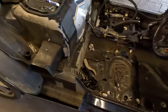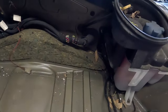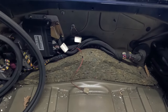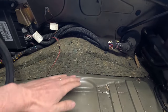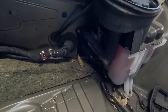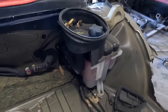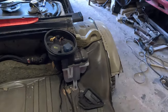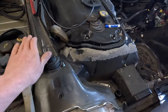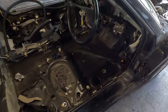There are some things I've seen that I'm going to have to change my plans on. I had planned to move the header tank and the wiring and leave a clean boot floor, but this header tank is so big and there are three pipes in the bottom of it — I just can't see where I can move it without ending up with some sort of airlock in the line. So that's going to have to stay. What I'm probably going to do is box it off, kind of like a Renault 5 Turbo 2, carpet it, and that'll solve that problem.